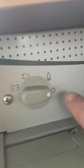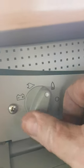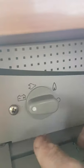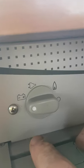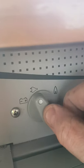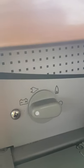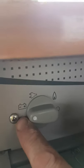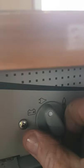Moving on to your fridge — the main control knob at zero is off. You have three different settings: the first is gas, the next is 220-volt mains when you're plugged in, and the last is engine battery which only operates when the engine is actually running. The plan would be: if you're going away tomorrow, put your fridge on the mains first and let it freeze overnight, then when you're travelling switch it onto engine so it maintains the cold. That setting won't freeze the fridge from warm — you need to freeze it up first.